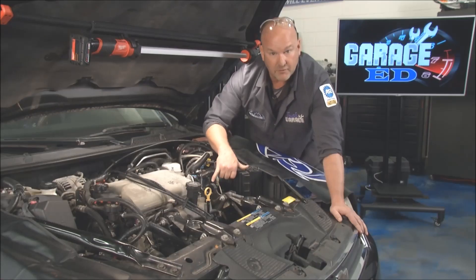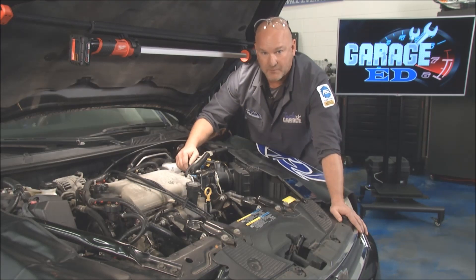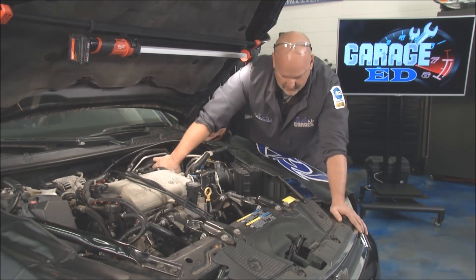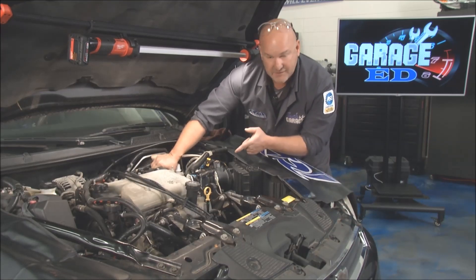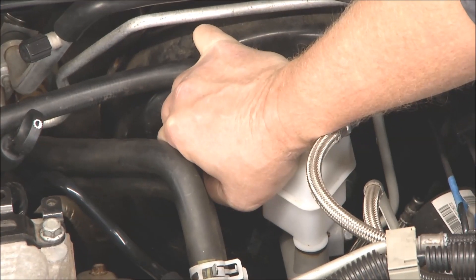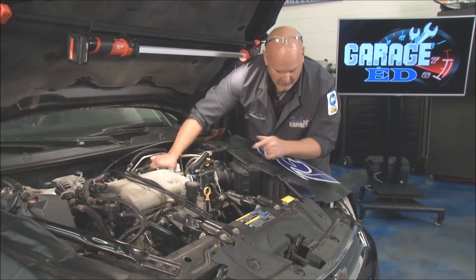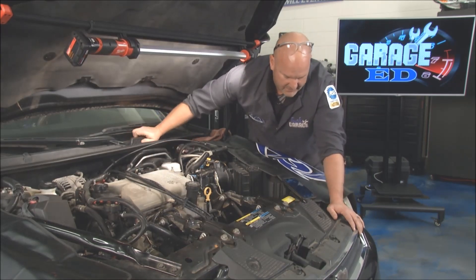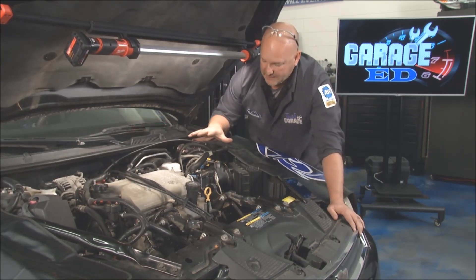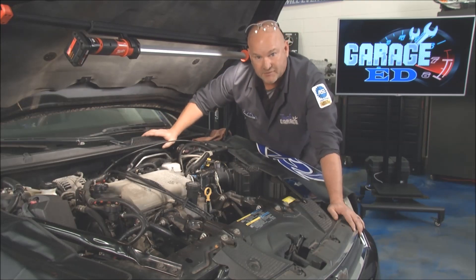If you load it up or have a vacuum leak anywhere, keep in mind those vacuum leaks will bite you. Let's pull a vacuum leak right here — you can hear it trying to recover, the ECU's trying to figure out where the unmetered air is coming from. That's the erratic behavior of the drive motor now trying to find home. When we put it back in, we re-stabilize, come back up, and that's how it works on a drive-by-wire system. So once you do your diagnostic and find a problem, Tom and John have your solution.